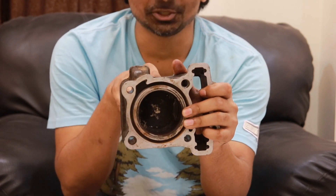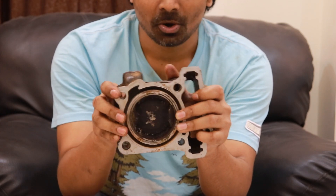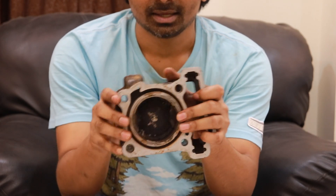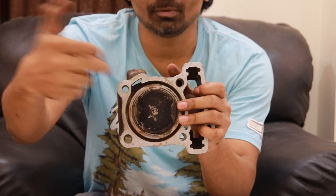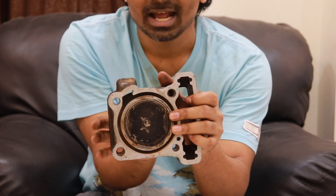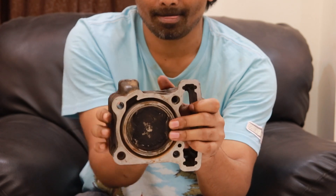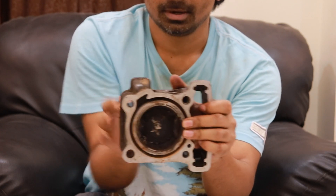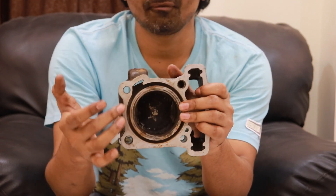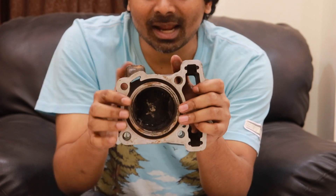It's tough, it's not easy to move because it's got a nice good seal around the cylinder walls. In the first stroke — the induction stroke — there would be two valves or four valves depending on the motorcycle, and the piston actually goes down. This whole area gets filled with air and fuel mixture.